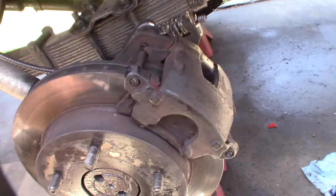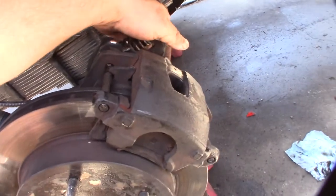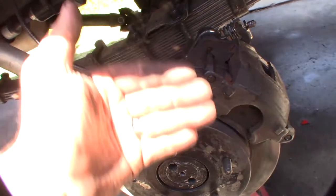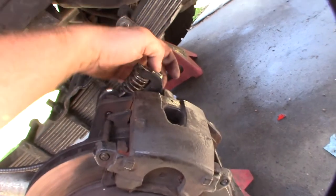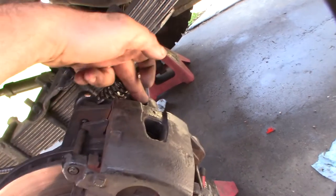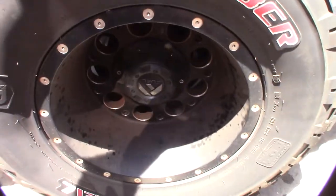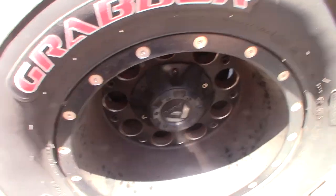These brake pads are like $15 each. I want this thing to engage right away — like barely moving it's engaging. If it goes past about 25 degrees or so, you're no longer getting enough contact area to clamp onto the rotors. These things have to engage almost immediately — when the gap is about two millimeters between the caliper and the rotor, it needs to engage. Alright, moving to the other side for the test.